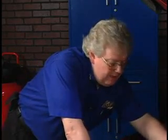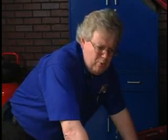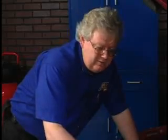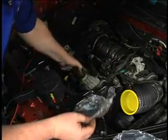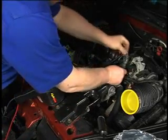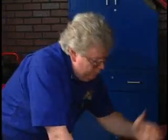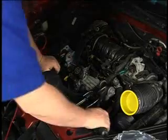Here's a technical tip: we could fix one or two leaks at a time, but before I send the parts chaser after a couple of parts, maybe we need more. Let's get a complete list first. Let's plug up those known leaks and see if we leak out anywhere else that may have been masked by the larger leaks. Take some simple rubbery plastic, small pieces, and stick them in the holes where you know the leaks are. Here's a small piece for our manifold fitting. Let's roll the smoke again — we're going to buy parts here and here, but let's see if we need anything else.